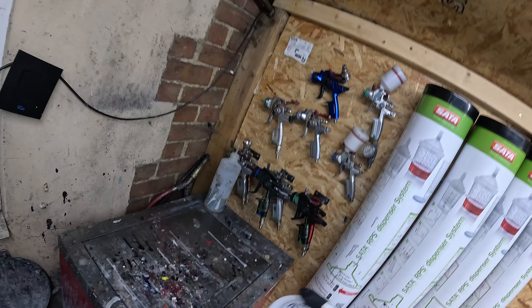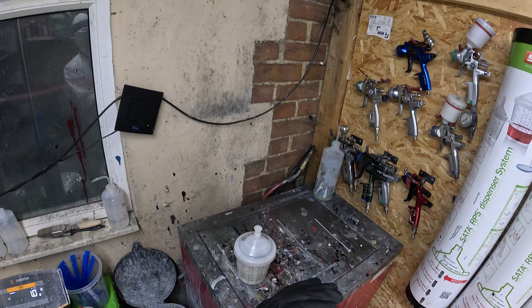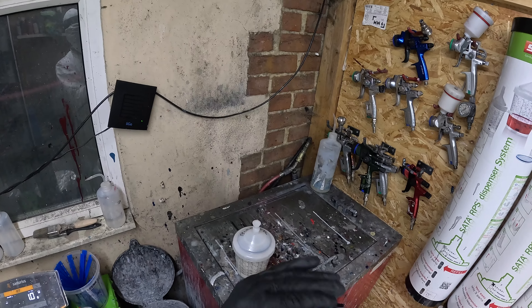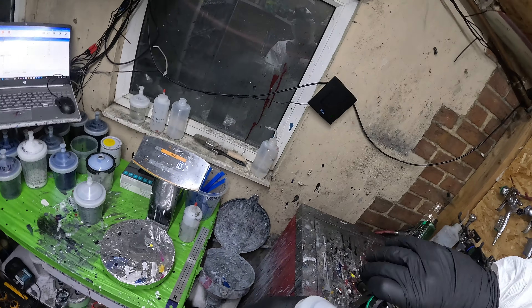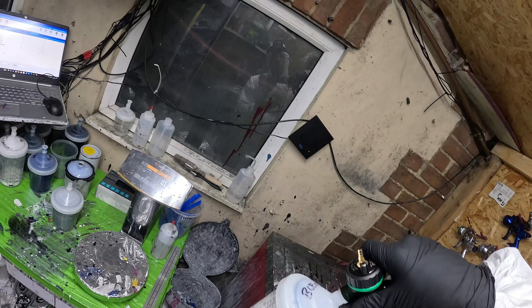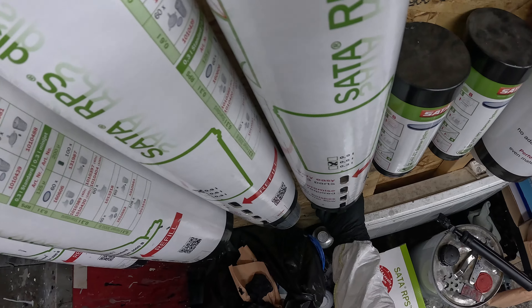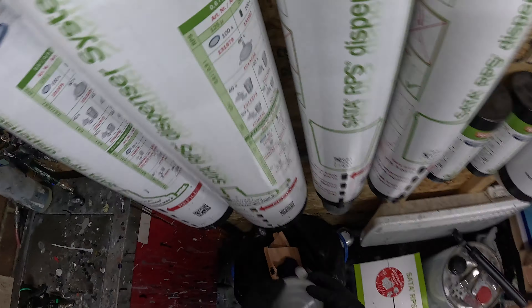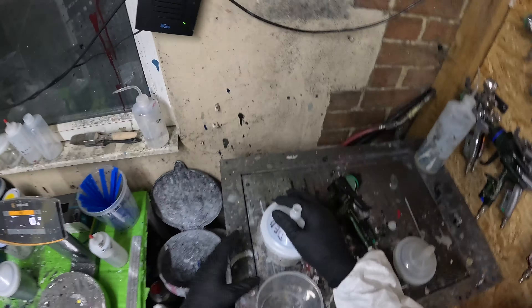The designated wet-on-wet for Mepa is F37, which is probably more suited to new panels, but this is fine for sealing in those doors. Whenever I do a wet-on-wet job, I don't mix the colour beforehand — I get the wet-on-wet on there first so it gives me plenty of dry time. The longer you can leave wet-on-wet the better, to minimize any die-back on your clear coat. Then I mix my colour while that's drying and clean the gun out — that 4+1 needs a good 10 to 15 minutes at around 22 degrees spraying temperature.